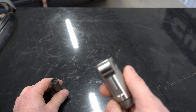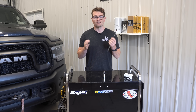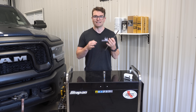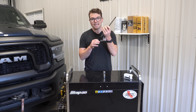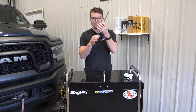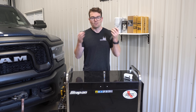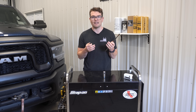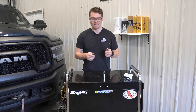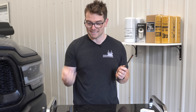You might ask yourself, why fix what ain't broke? Why go to a hydraulic roller lifter? Apparently it's all due to maintenance. A valve train needs a specific amount of backlash or play, because as metal heats up and expands there needs to be room for expansion between the components. From time to time you have to adjust that play or backlash, and that is the maintenance that Cummins is avoiding by using hydraulic roller lifters instead of solid flat tappets.